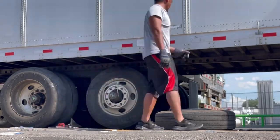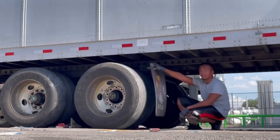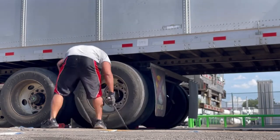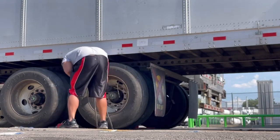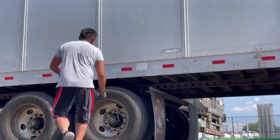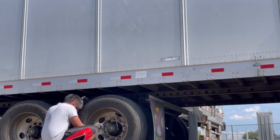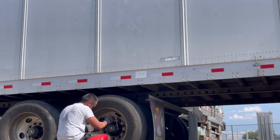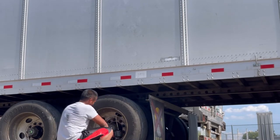The pry bars make quick work of lifting the tire and getting it lined up. All I did was play with the pry bar to make it move one way so I could get it to turn. After you get everything set, make sure you hand tighten all of the lug nuts one at a time. Once you know for sure it's threading on pretty good, my Milwaukee has four impact settings from one through four — start with the one setting and get it seated all the way around.